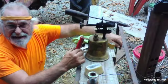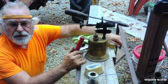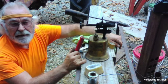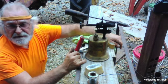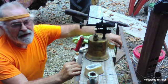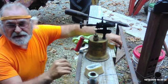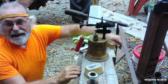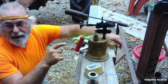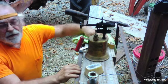I'll rub that iron on the sal ammoniac block — it'll turn black as it takes the impurities off the iron and puts solder on the tip. I'll be able to turn that tip reasonably shiny. Now we're going to stick it on and see if we can run a little bit of solder. Well, I hope you all can appreciate how much better we have it nowadays compared to the old days. I'm fortunate to have had some experience working with these things, though they were definitely on the way out or completely gone by the time I got into my career. Did I ever master the process? Heck no. The main thing is it's going to be covered up, and I need to get that machine back on the road. If we're a little lucky, that 270-degree crack around the perimeter of that neck should hold. I'm going to shut the torch off — just about out of gas, estimated about right.